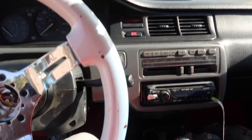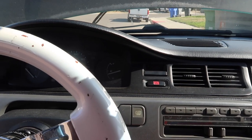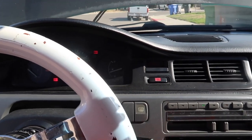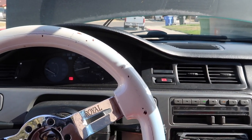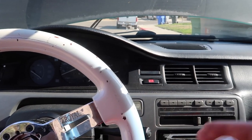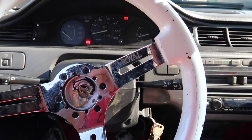Mission complete. I also did the loosening of the alternator belt — hopefully it doesn't squeak anymore. It's squeaking a little bit more, let me figure this out. I think what happened was my belt was a little too loose — I thought it was too tight so I loosened it, then tightened it back up, and now we have no more issue with the belt.